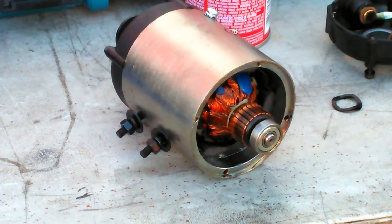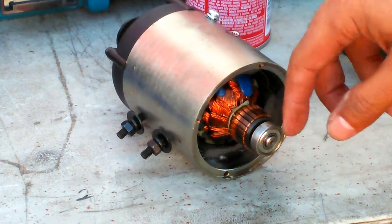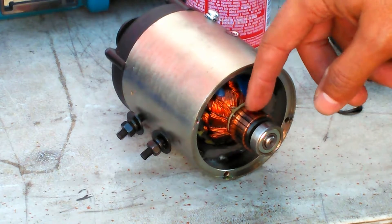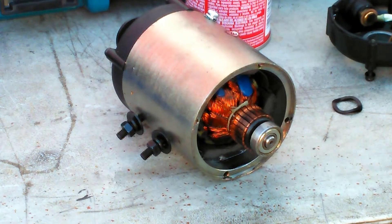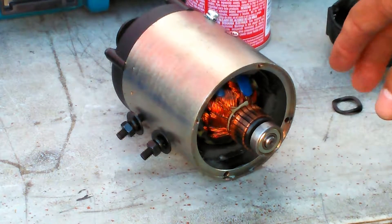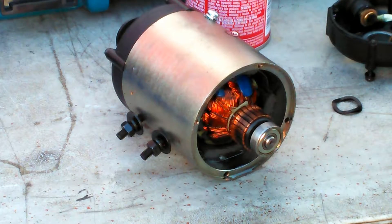Just for your edification, it is pretty clear to see the buildup of graphite here. That graphite could be a real problem - it looks like there's quite a bit of buildup. Now these are copper contacts, so they should be bright and shiny, but they're not. I've been using this thing for years and probably logged maybe 1,000 to 1,200 hours on this thing easily. I'm pretty sure there's no shorts in there because there was never an issue with dead shorts or any arcing.